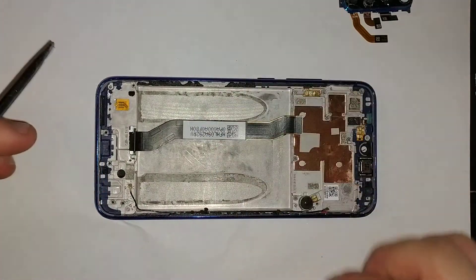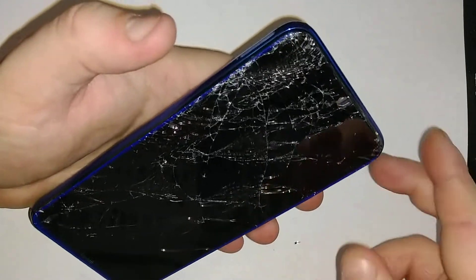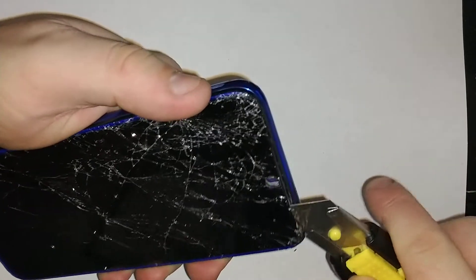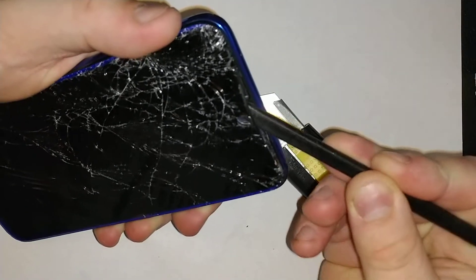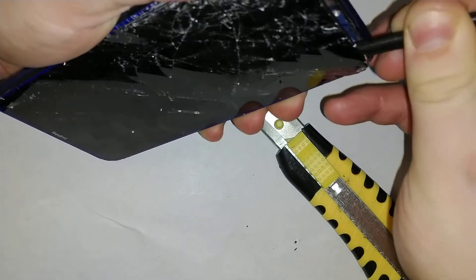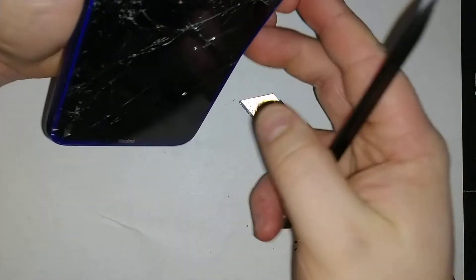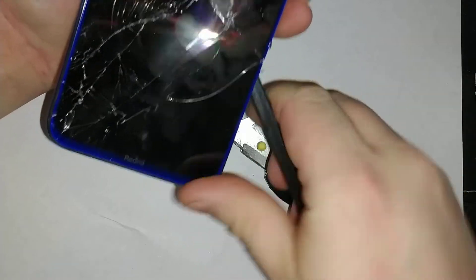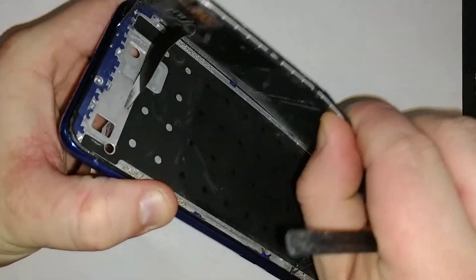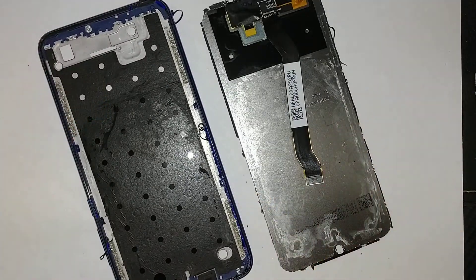There's your screen cable. If you want to remove the screen from the frame, you'll need a knife and start in the corner, lifting up the whole display and going all the way around. This can be a bit messy and you'll need to clean the frame very well before installing a new screen — it's pretty much glued to the frame. As you can see, it just came off and there's your cable. Thanks for watching — if you like this video please like and subscribe for more videos.